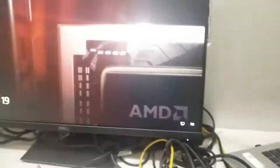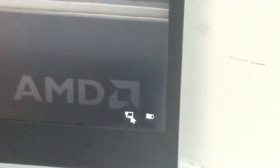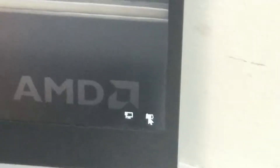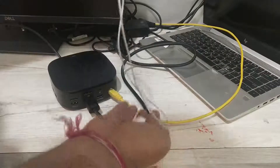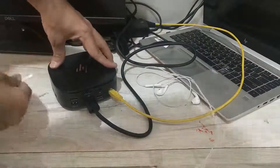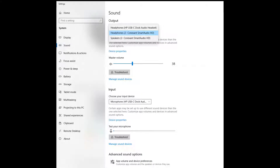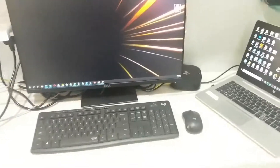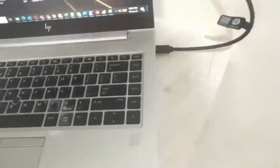As you can see, it has immediately picked up the laptop display. It is also charging the laptop, and I have not plugged in my regular HP charger or network cable to the laptop directly. It has also connected to the wired network. For the audio jack, I couldn't hear anything at first — the trick is to go to audio settings and select audio over USB-C, and now I can hear. I also connected the USB charger to charge my phone, and yes, it works and charges my phone as well.